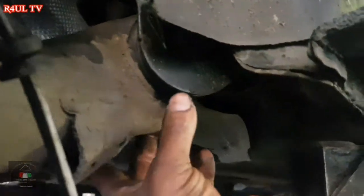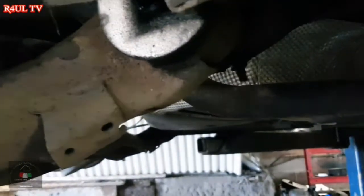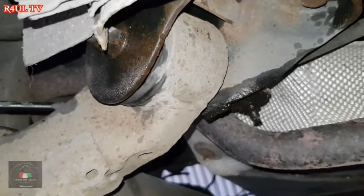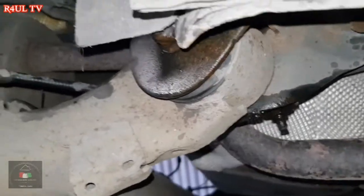What we're going to do now is put WD-40 on the shocker bolt and on the trailing arm. Let me turn the light on so you can see it better. This is the trailing arm in here, and that's the bush — that's the culprit, that's the thing we're changing. Basically that needs to come down.